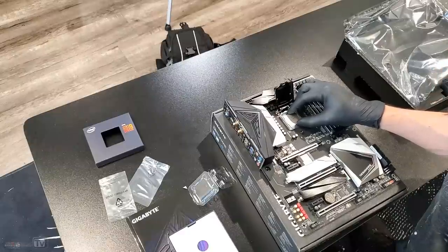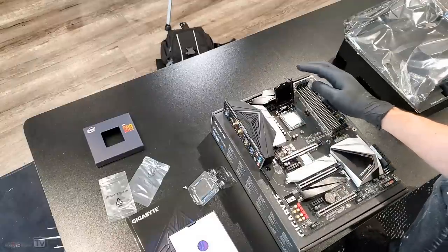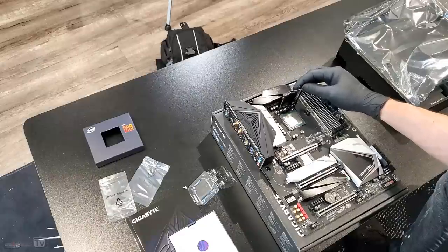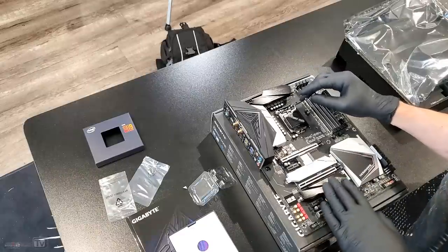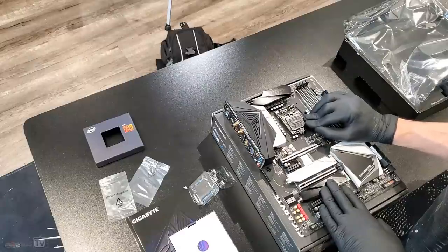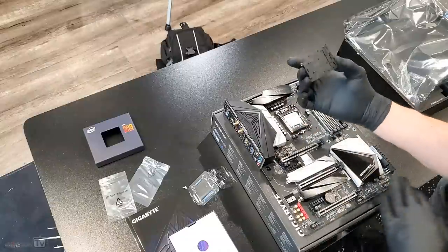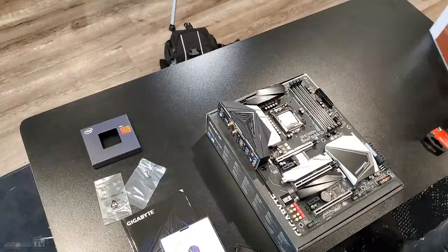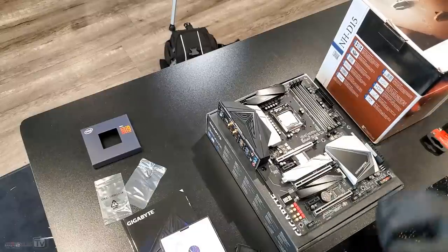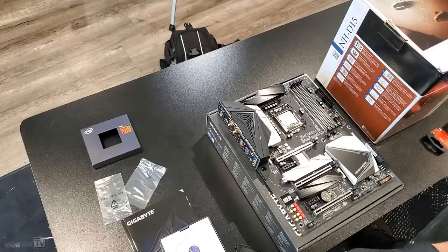This corner goes that way — we just let it sit and rock it a little bit to make sure it's in place. If you mess up this part it's gone. So now we close this, the cover pops up. Now that the processor is in place, we're going to mount the Noctua heat sink — but of course putting the thermal paste on first. I have two brands, we'll pick one.